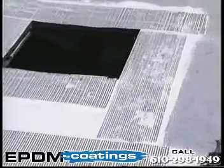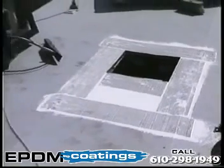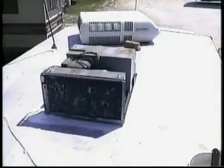The air conditioner should be removed and the gasket replaced when coating an entire roof. Apply liquid roof around the area to be covered by the AC housing. Set the air conditioner in place with the new gasket right on the wet rubber.